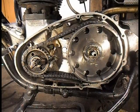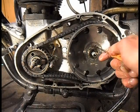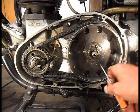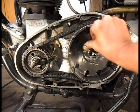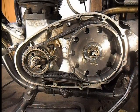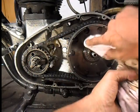And there they are, all inserted. So that's the rollers. Now they should always have a little space. It's about half a roller space. That's the space. So, double check. They're all in, and they're all upright. You can see them quite easily on the edge when they're upright. So that'll do for that. And all that grease off that thread. And this bit of grease over here.